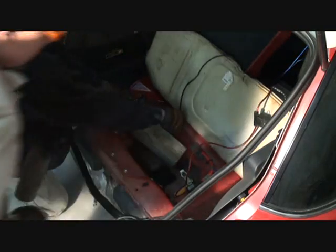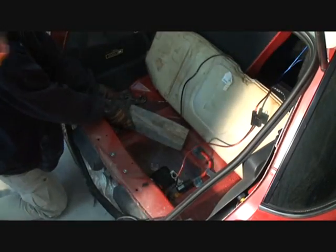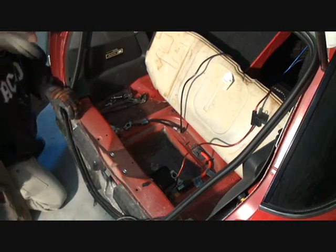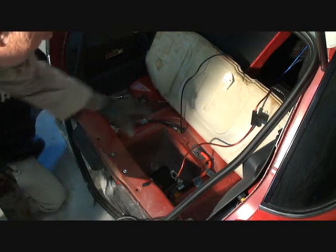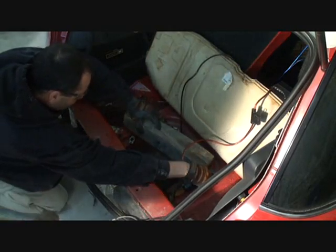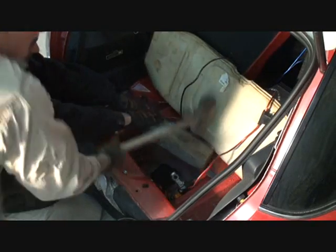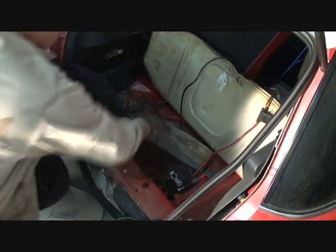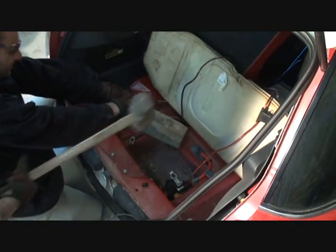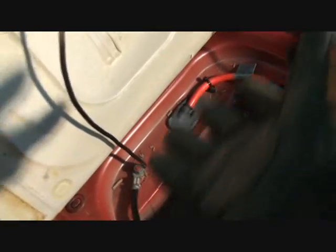See if you can move it back a little. Right there. Now, if you take a look at that box, you can see that it's flat — it's not buckled up anymore. One more time, Rich. Let's get that corner right there. Make sure you brace that block right there — I can't hit it when there's a cable in the way. Bring it over here, a little bit more right there in that area. What we have done is we've actually straightened out our battery box — we've moved it back. It was all angled up in there.